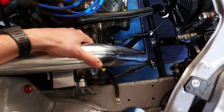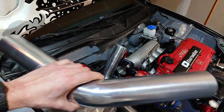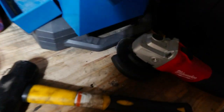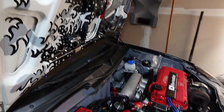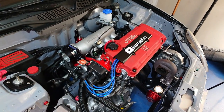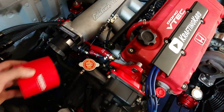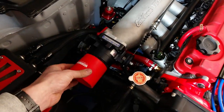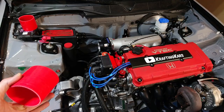Basically this pipe will be right here, then we'll have a 45 kind of here, and then the last 45 will have the piping end up going into the intercooler. I'm going to start marking out everything, get the general location, bust out my Sharpie, mark where I want to make my cuts, and then I'll go over to my buddy's house to get all the cuts done. In my opinion, intercooler piping looks the cleanest when you don't use a bunch of silicone couplers. For my charge pipe setup I plan on only using one on the throttle body and one down on the intercooler, and with those two couplings we still have quite a bit of wiggle room — side to side and front to back — which makes me feel comfortable about eyeballing my cuts.